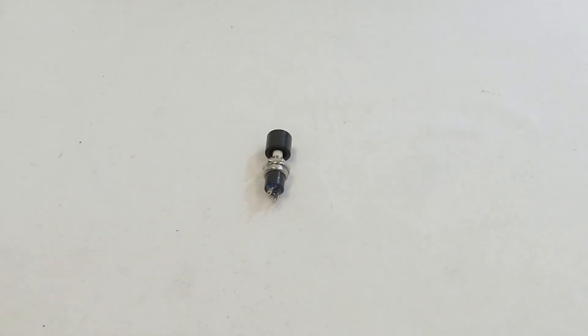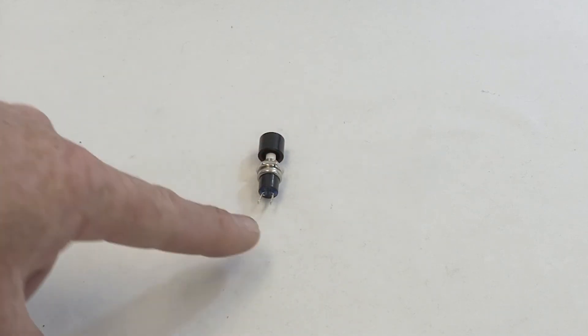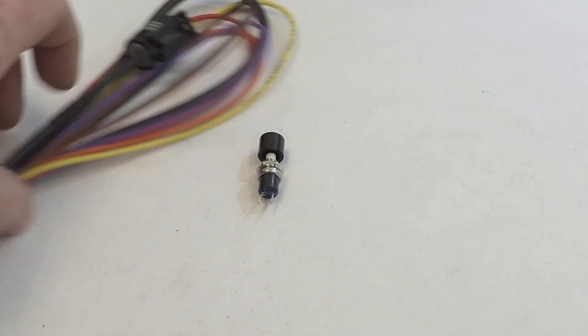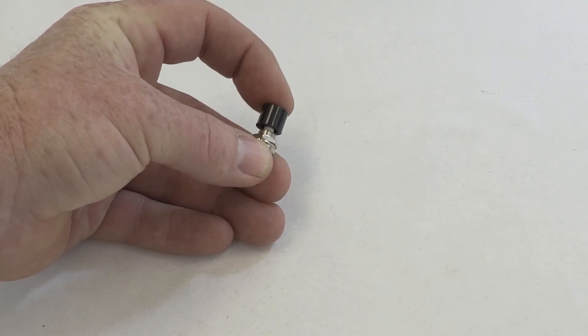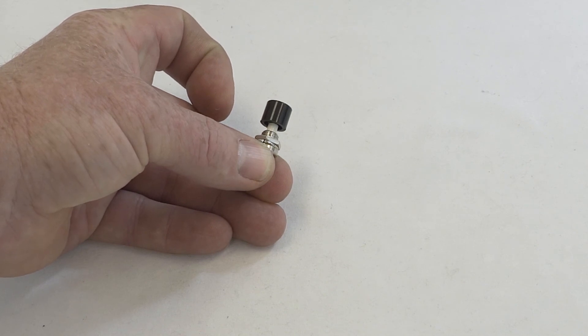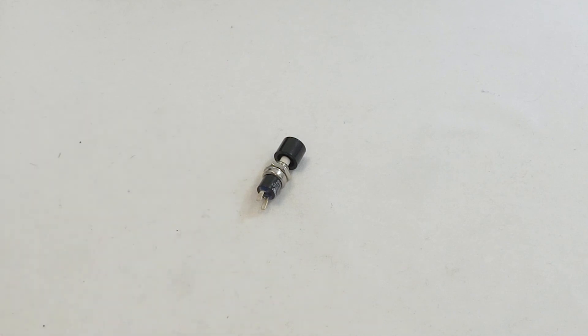This is your valet switch. It is used when you are using sleep mode and it's also a backup if you forget to charge your controller or you lose your controller. Either pin can be wired directly to 12 volts to the battery of the vehicle, and the other wire is directly wired to the purple output wire on your main harness. When you press this once with the vehicle in sleep mode, it will come to ride height. If you press it again, it will raise the vehicle to your saved height number three or lift, and if you press it again, it comes back to ride height. It's simply designed as a backup for your system, but can be used for general everyday use if you don't wish to use your controller.